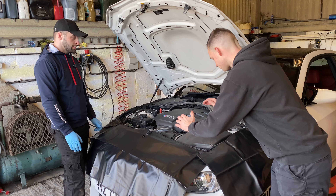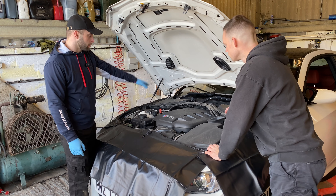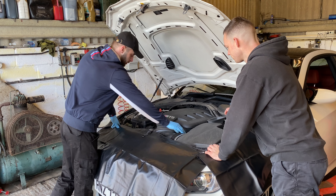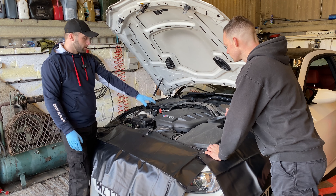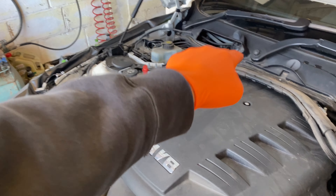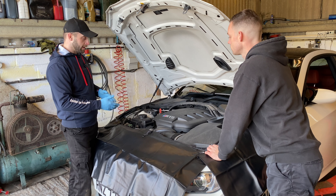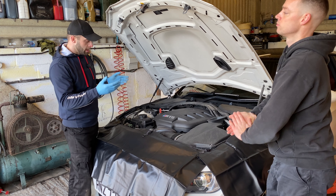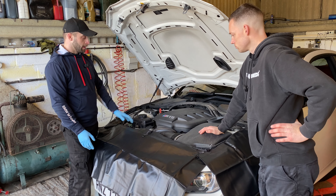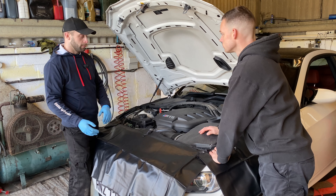To get to the actuators, there's quite a lot to come off: microfilters, microfilter housings, top scuttle trim, a few wiring looms, the airbox, link pipe, vacuum pipes, a few sensors, another vacuum pipe to the back of the inlet manifold. The whole inlet manifold - or plenum on this engine - has to come off. The exhaust manifolds are on the outside, unlike the newer V8 turbos. All the workings go in the middle of the V where the throttle actuators sit.